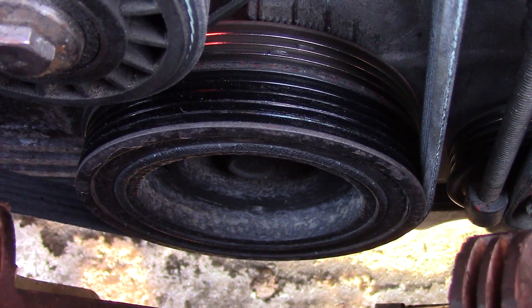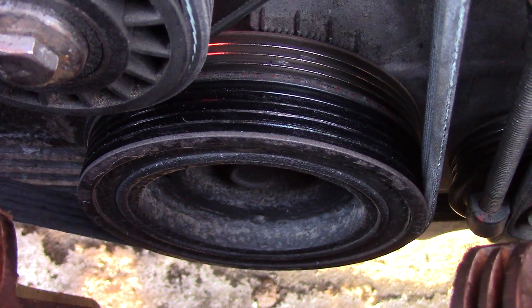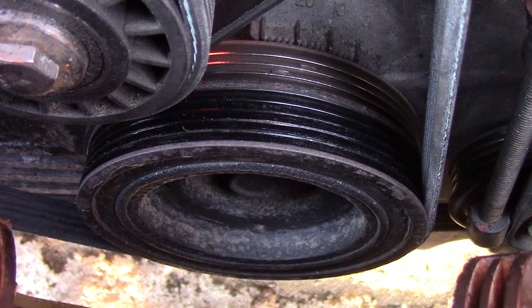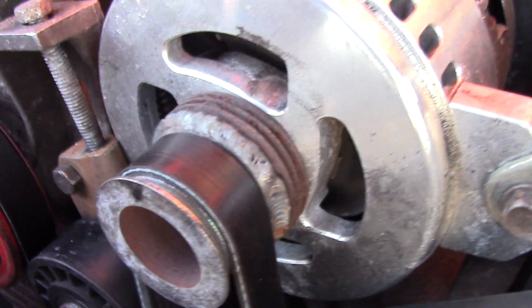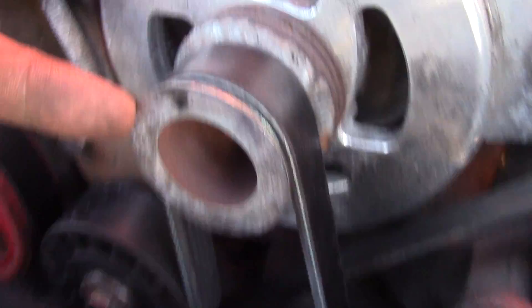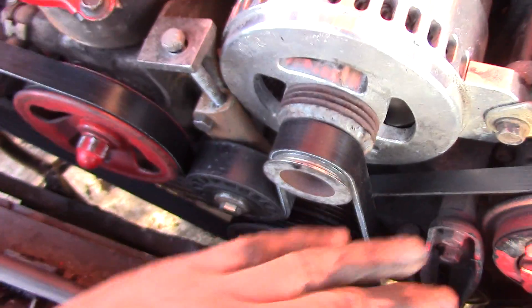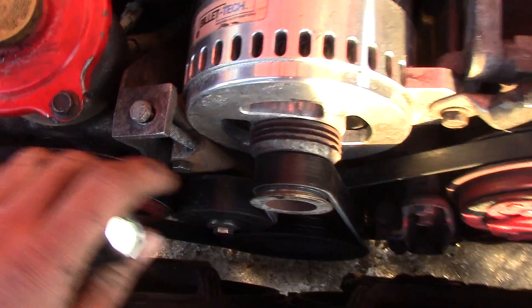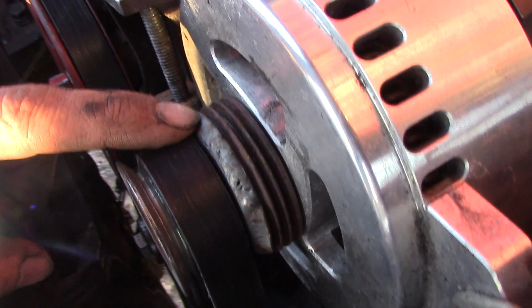What I'm going to be doing next is upgrading to a six-rib, six-inch diameter crank pulley — if you know any engines with that configuration, please let me know in the comments. The stock one is five-rib and 5.33 inches, which isn't quite cutting it. I also have a custom pulley I ordered online — it's actually very small compared to my hand, it's six-rib, and I cannibalized a stock Subaru five-rib pulley to make it work.